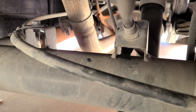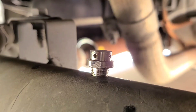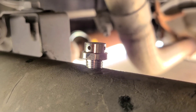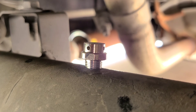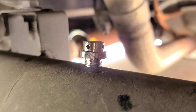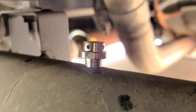So it's just going to go right on where the old one came off. One thing you want to make sure is you clean that off real good — make sure there's no mud or debris or anything like that going to try to get in there. I just have the new one started just to get the threads going so I can show you guys what it's going to look like. You're going to go ahead and get it tight, and once it gets tight just give it a quarter of a turn to snug it up. You don't want to over-tighten these guys — it's not a good idea. All Dogs even offers a little piece of paper that tells you don't over-tighten, only do a quarter of a turn.